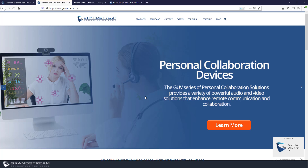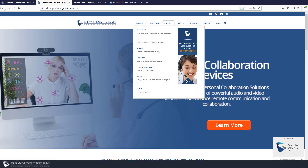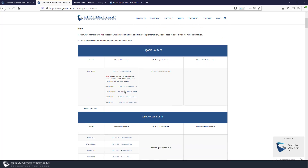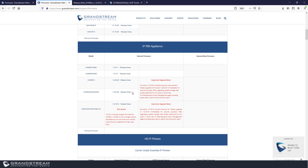On a regular basis, all Grandstream product software are updated and the latest firmware versions are available on the Grandstream website by going to Support > Firmware. New firmware versions are published to include new enhancements and fixes for reported issues, and all changes are added to the release notes. Before you start doing a UCM upgrade, we always recommend reading the release notes, which may include special firmware upgrade notes — especially if there is a security or major bug that you need to pay attention to.